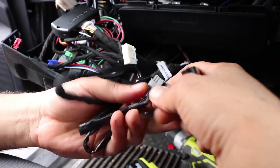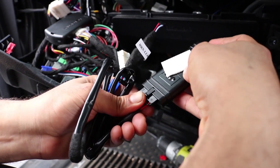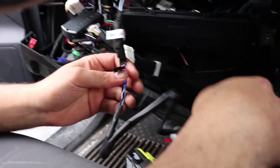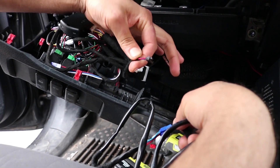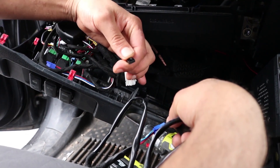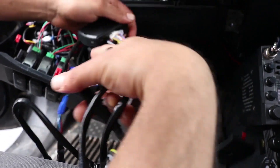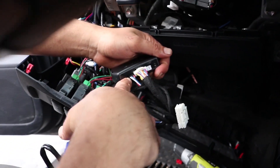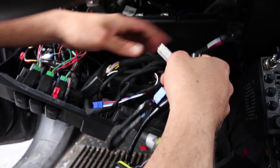What we're going to do is plug in the flat connector into the module, and grab the black connector with the key or tab on top — a clicker, whatever you want to call it. It's 4-pin, identical to the one you used originally to program the remote starter, except this one has a tab. This is going to be your power.